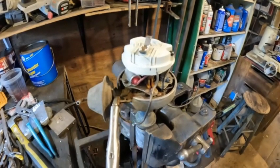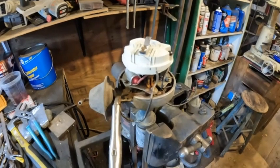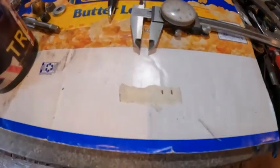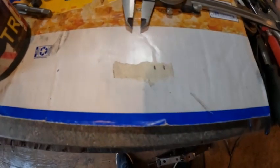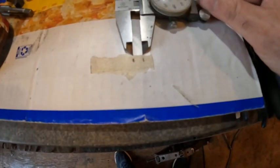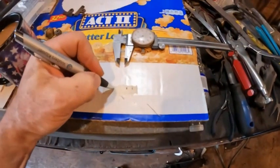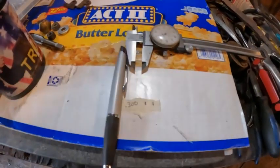There's a little bit of math you've got to do to translate that into a number, but it isn't that much. I put this tape down onto a piece of cardboard so it's flat, because measuring a curve you're not going to get any really exact number. So that works out to three hundred thousandths, and I'm going to write that down on the tape. Then the next step is to go to the chalkboard and I will show you the math.